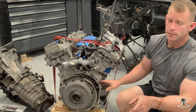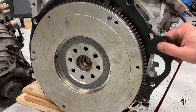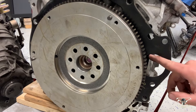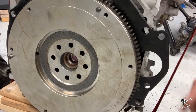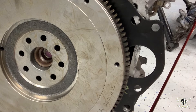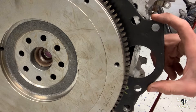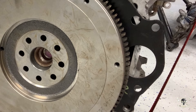For mock-up purposes I just have the Toyota flywheel back on here, and this little backing plate is a spacer plate from a Toyota pickup truck — it mounts with almost the same bell housing pattern. You can see the provision that bell housing gives to access the flywheel's ring gear to start with the starter motor. The main interference is right here where you can see the casting is going to interfere with letting this starter motor pass through, but in general cutting this out and relieving that area and adding this to our adapter plate should give us provisions to get a starter in here.